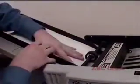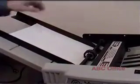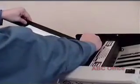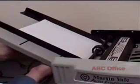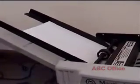pretty much until the center of the paper rests on this wheel right here that actually pulls the paper into the machine. So once you have those side guides adjusted, and you want to give it a little bit of room so that it doesn't hold onto the paper and keep it from being pulled in, just tighten those back up on the bottom, turning them clockwise, and you're good to go.